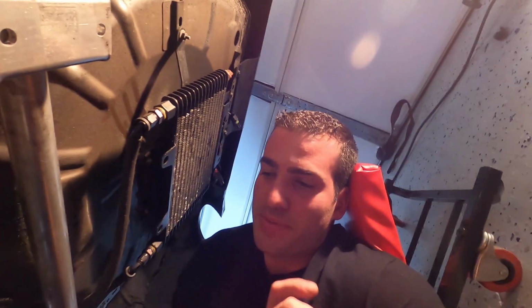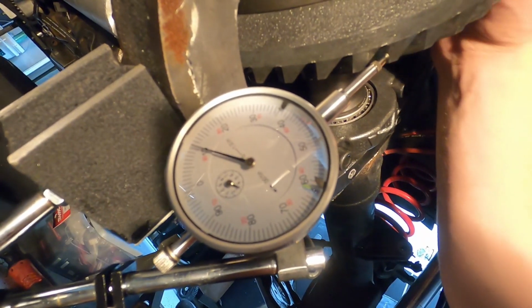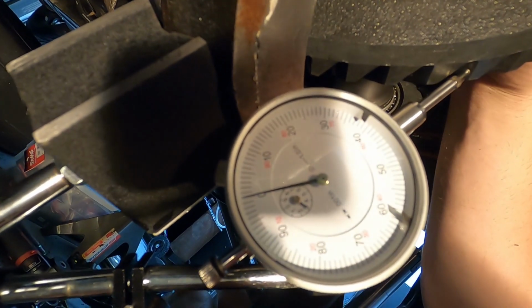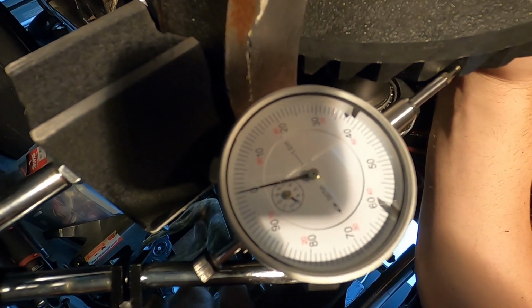Well, as I suspected, I did not video at all. One, because I put it in and I was like, well, there's no way I'm gonna be anywhere near correct on the first try. And I threw it in there and I went to go check the backlash, and it was pretty decent. So you can see we're at 10, well, 0 and 10 on the first shot. So I'm not gonna mess with it. That's gonna be it. I'm gonna leave it, because how often do you guess on the shims and get it exactly in spec?